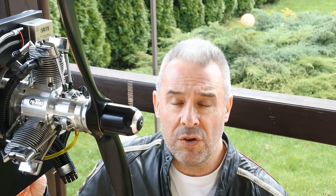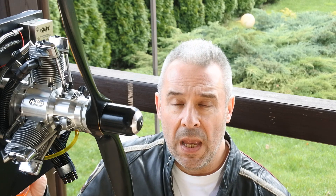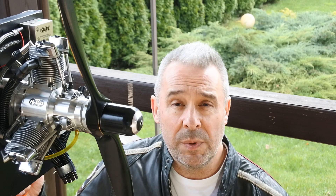If you remember these stories, the engine really showed excessive vibrations, especially in the middle and low revolutions. I got advice that there is a cure, and this cure was developed and produced by CH Ignitions in the United States. It's a specially designed flange, because the main problem of these vibrations was the uneven and incorrect firing of the second and third cylinders, which made the engine a little bit shaky.